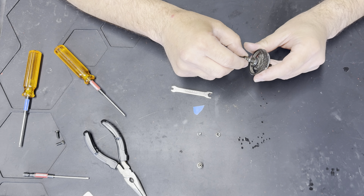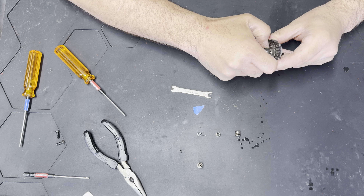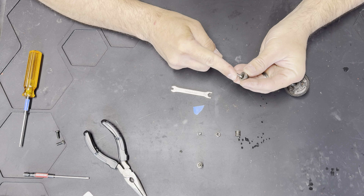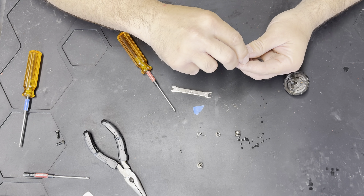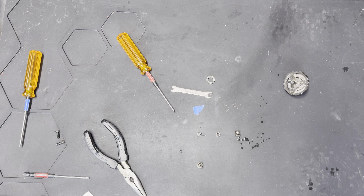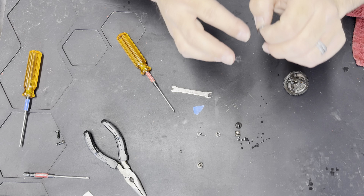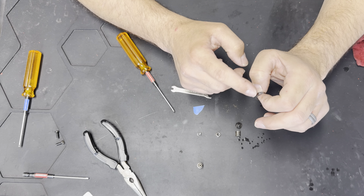Put the locking nut aside, take the spring off, and you've got the bearing and bearing carrier — pop that out right here. Let's clean these off so you guys can take a look. This is still the plastic bearing carrier — I did not get the aluminum one, and honestly if I were you guys I'd stay away from aluminum. This bearing has a slight rough spot — let me check — actually, it's not too bad, we'll go ahead and keep it.